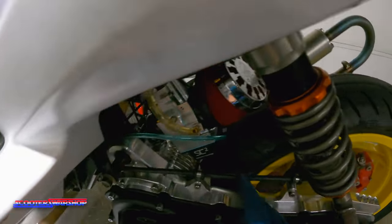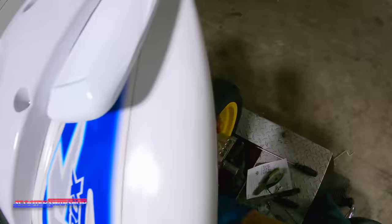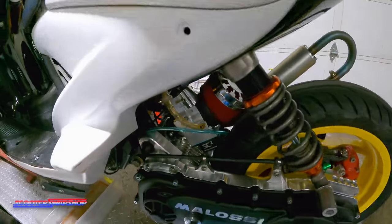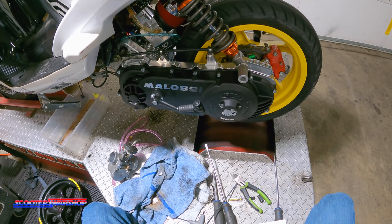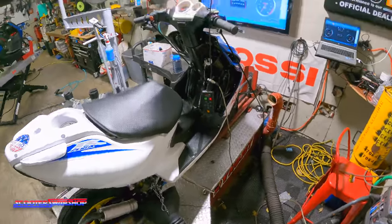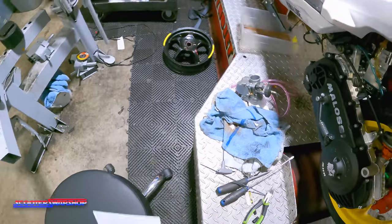Okay. All right, so now we've got the fuel line on, we have the throttle cable on. Ooh, I don't like that, because it's sticky. Let's see here, again. Choke and slowly open the fuel cap when filling. Turn the fuel off, so choke's on. So we're gonna slowly fuel it here. Okay, so that guy's open. Start by using the clicker just top of the carb to adjust fuel flow. With the engine off, hold the throttle wide open and depress the clicker adjuster to engage the clicker mechanism in the throttle slide. So we're gonna go wide open. We're gonna click the top here. Clicked, okay. Now I think we can put the choke on and start this thing, see what happens.